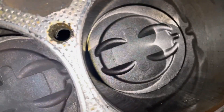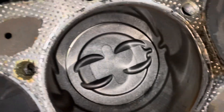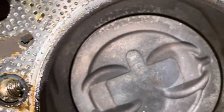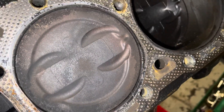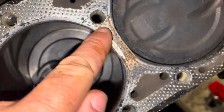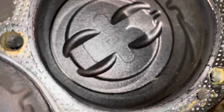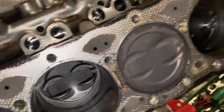On the starboard side, cylinder number six shows a little bit of cleanliness up in that corner, and a little on eight at the top. Cylinders two and four look kind of normal — though I can see a little what looks like a blown head gasket right through here because the color isn't the same. I believe there might have been a blown head gasket between these cylinders, but this side was minor compared to the other side.